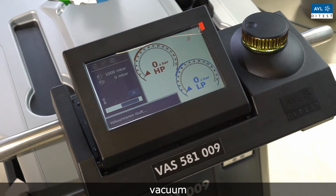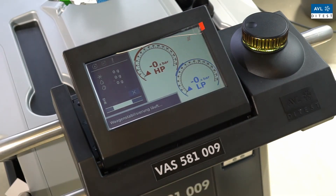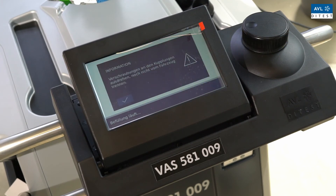The functions of draining, vacuuming, pressure test, and filling are performed automatically. During the pressure test, the vehicle air conditioning system is filled with a set quantity of refrigerant of 70 to 300 grams. A pressure loss is determined over the selected time period, which detects possible leaks. Follow the instructions on the display.